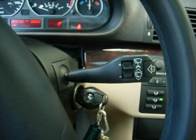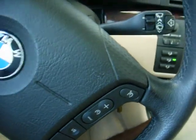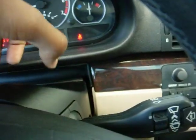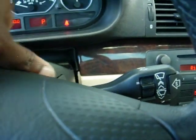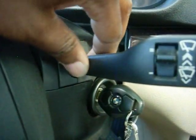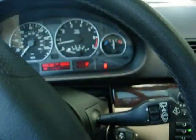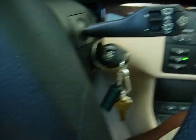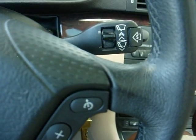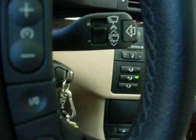So I'm very happy with it. I'm going to take the car out on the road to test drive it. Installation requires removing the steering wheel — to do that you have to unplug the battery and disarm the airbag. Once you remove the steering wheel, you just lift this up and pull it out of the slip ring switch center. Putting in a new one is really easy; it took me about 10 to 20 minutes, and I did it on the side of the street since it was too hot in the garage. It adds something extra to the car, so I'm pretty happy with it.